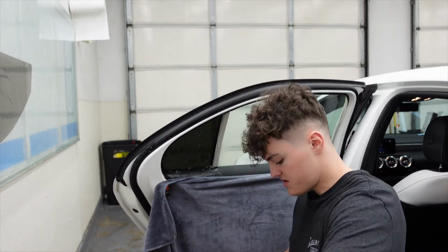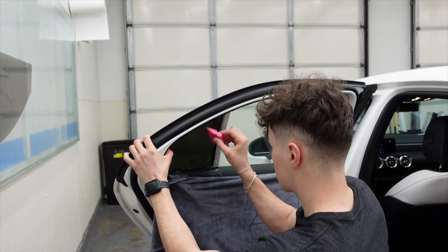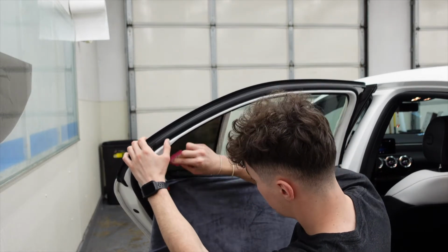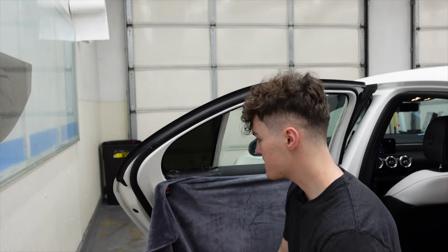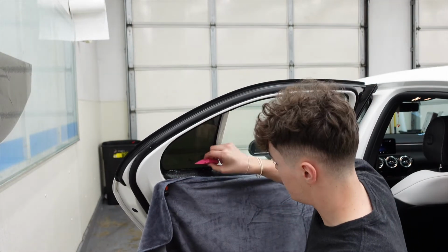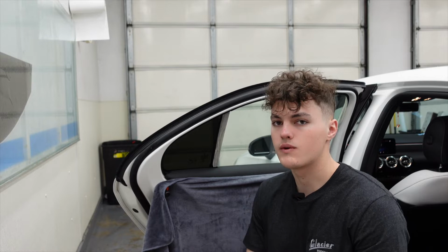And then once I've checked that, I'm going to squeegee out the clean soapy water, grab the same little pink squeegee. I'm going to hold the pattern with my thumb to make sure it doesn't move as I squeegee, just like this. Which it's not. I like to squeegee inside the dots first because that typically will hold the window tint in place. So I try to hit the dots all the way around, then I come down to the little bug right here and hit that.